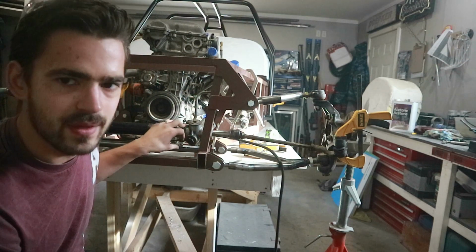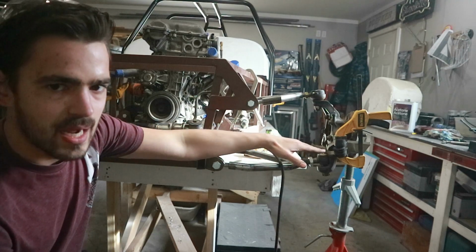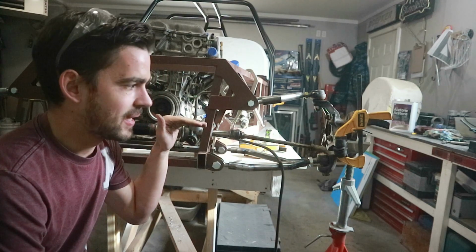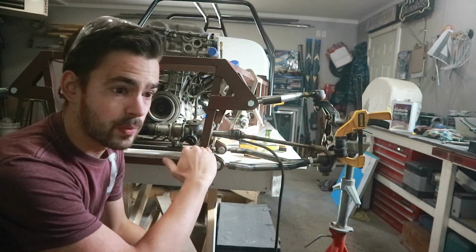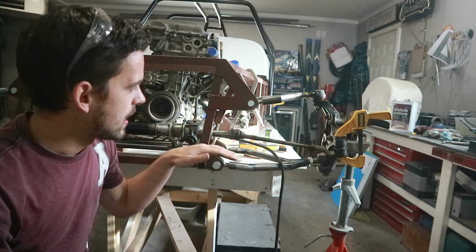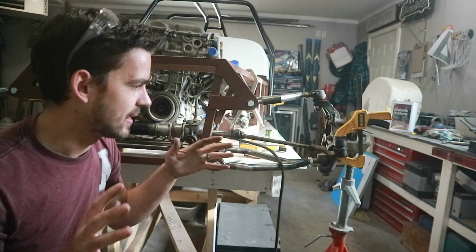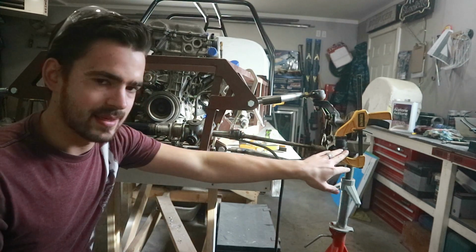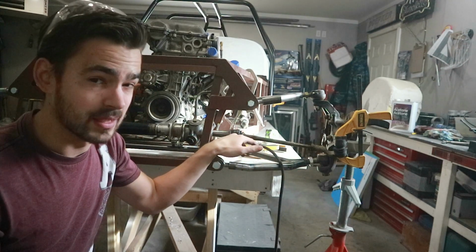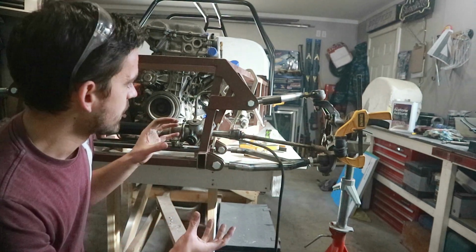All right, with those pedestals on there, it's raised the steering rack up high enough that now our tie rods are actually at a bit of a down angle at ride height. I don't want that. I want them to be pretty well level at ride height. That'll reduce our bump steer. Because our rack isn't the perfect length, it's a little bit long, we're gonna try to get as close as we can to level here to reduce the bump steer, because we are gonna induce a little bit with the rack length. So we're gonna drop the whole thing down.